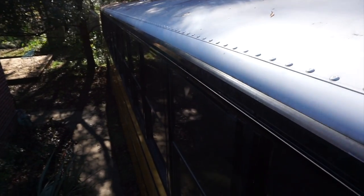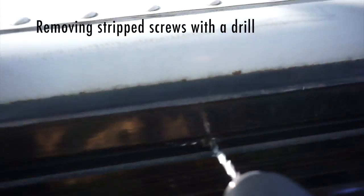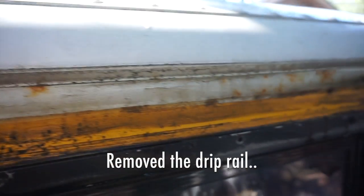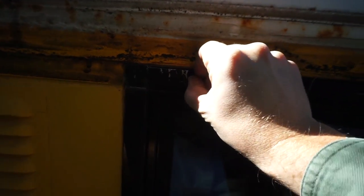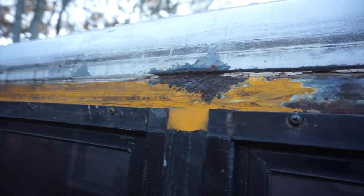Look, it's coming off. I'm pretty sure that when I take this off I'm gonna find some rust behind it. Hopefully it'll be our only problem, but that is wishful thinking. Eventually that's gonna go through and I'll pop it off with a hammer. A little bit of mildew, and there are two screws missing from this window. There's rust. The big thing is I've got to get these windows screwed back in so that they don't leak. I cleaned these with an angle grinder and a brush attachment.